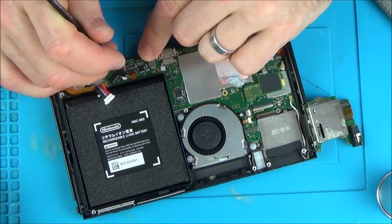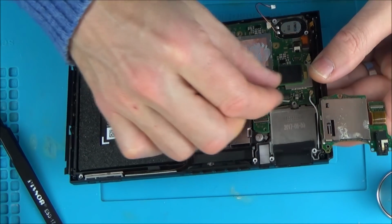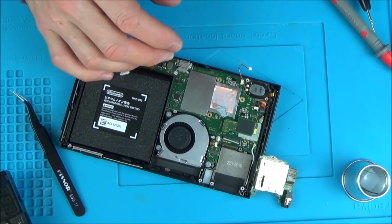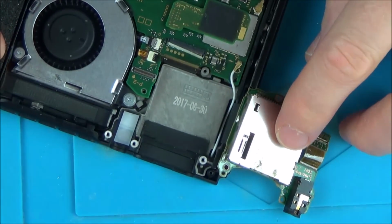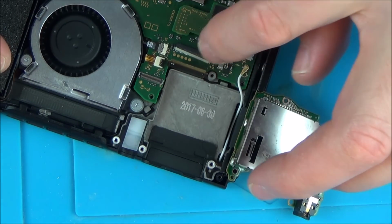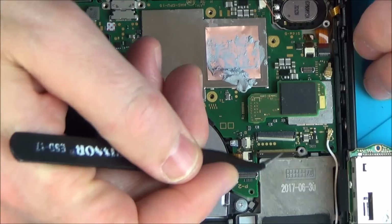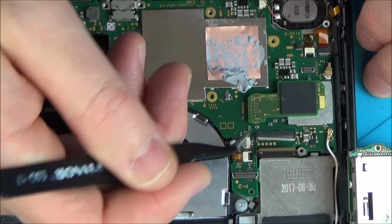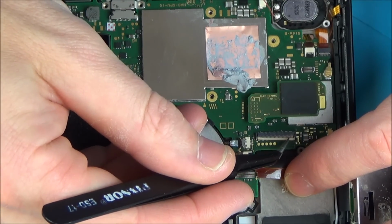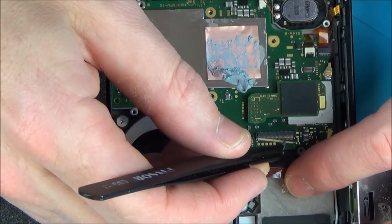Oh, have a look here. God, hold on a minute. I've just knocked that thing off. I was about to say I've seen corrosion. There's corrosion on this bit here. So there's water damage up here, which has probably leaked onto something up here, which is causing the short into earth over here. But now look, I've just knocked this thing out of it, which is a pain. I have real problems with this connector on all the switches I work on. It looks like this one's no different. Now I wonder, can I salvage this?